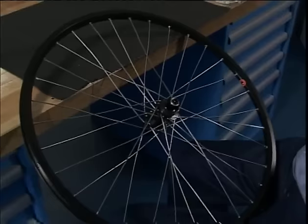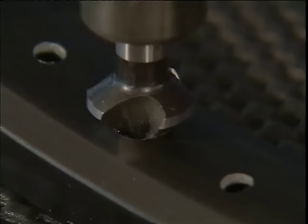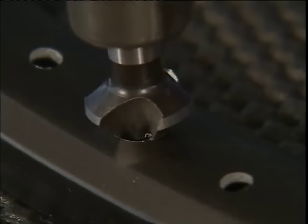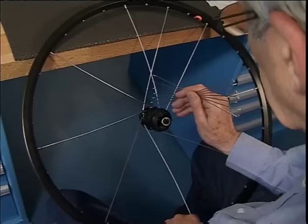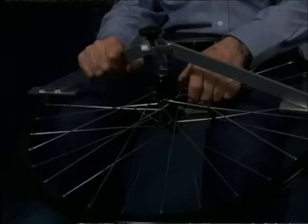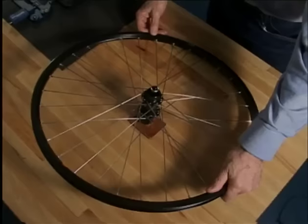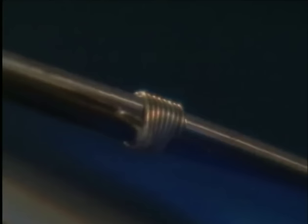There are many steps to building a wheel. Determining the correct spoke length. Preparing of the rim, the hub, and the spokes. And spoking. Truing the wheel laterally and radially. Dishing the rim. Optimizing the spoke tension. Repeatedly cracking or de-stressing and retruing until the wheel stands. And finally, the final check. Working time, 1 full hour. Then there's additional tying and soldering work for another 30 minutes.